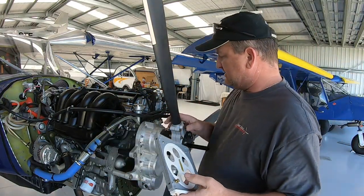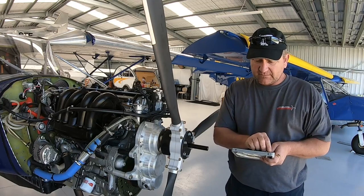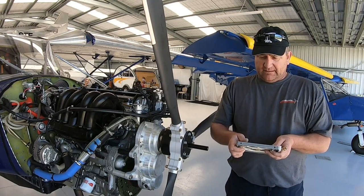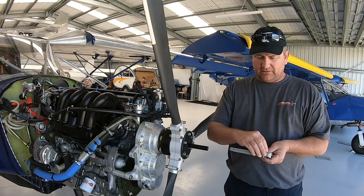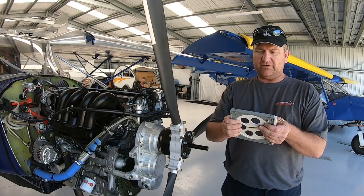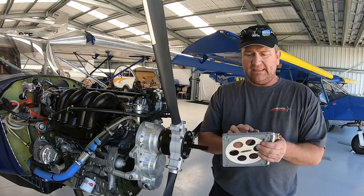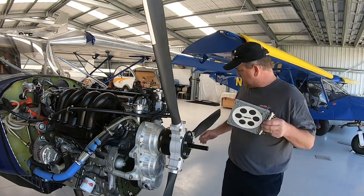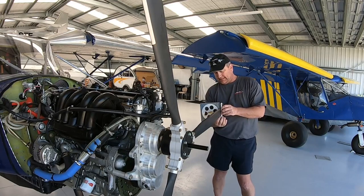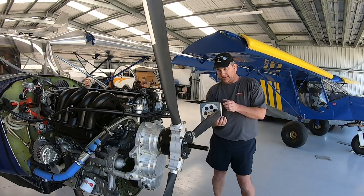And I know from previous experimentation that my everyday pitch setting is 13 degrees. So I will set my zero point at 13 degrees and lock the little locking screw, and that stops it from moving. But it pays just to check it every blade, to make sure it's still on 13 and that you've still got the point at the top, which is this little locking screw here, and use the point. So I come right to the outside edge, center of the blade itself, and just do up your little wing nuts. Just so it's snug.